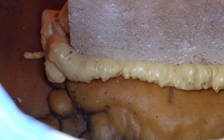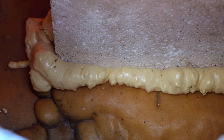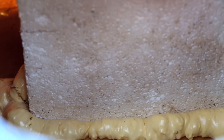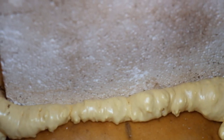So you can just barely see the block there in the hull. This is looking through the hole. And you can see two different colors of foam there. There's the light yellow, which feels just like hardware store foam, and then there's a darker yellow underneath it. That's original to the boat. So someone at some point has attempted to fix this, but the repair didn't last very long. And from what I've read online, that's not uncommon when the styrofoam comes detached inside the hull, to try and fix it and have it not last very long. But we got to open it up anyway to dry it out. So while we're in there, we'll see if we can fix this.